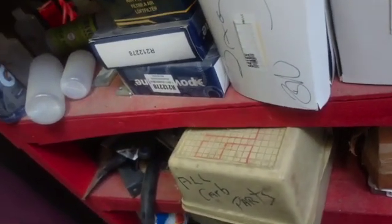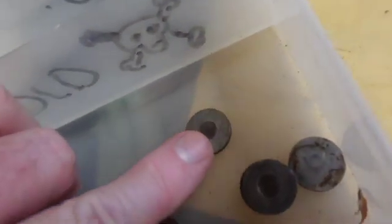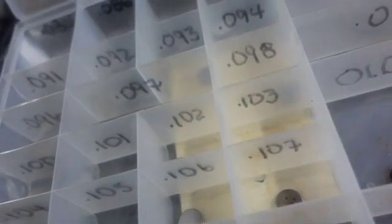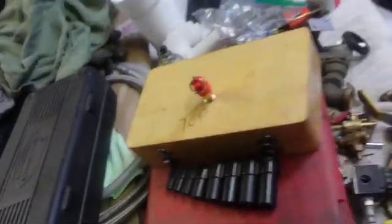The Archer kit. So you have to have, if you're going to adjust the valves, even on a Lexus or anything, you have to have this. And you have to have these shims. And you have to measure what you have. See where the cam wore into that one? You have to know what you have. If it's 6 thousandths on exhaust, 4 on intake on the cam lobes, then you have to compensate with these little shims. But you can't put these shims in until you take the camshaft out. So let that be a lesson to you.